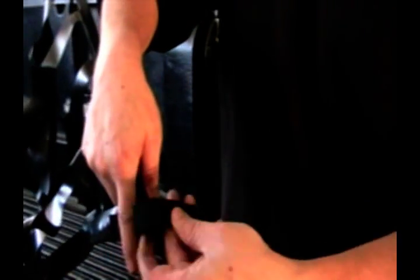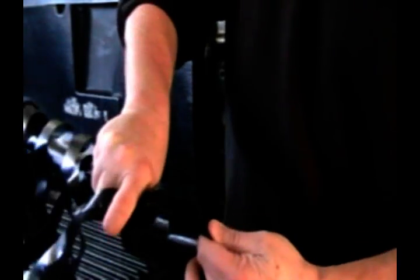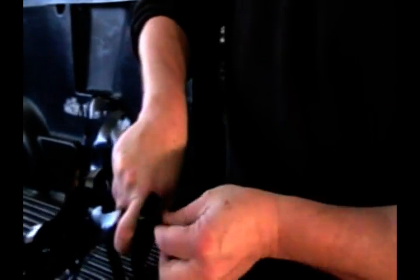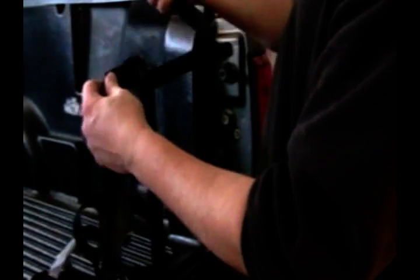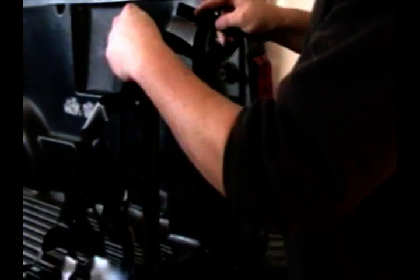What you do is come through the back side of the hole closest to the back of the buckle, then come back through the hole closest to the end of the buckle which has the little thumb catch on it, and pull it through like that. That way it tightens up on itself and the wind won't pull it loose. If it doesn't have a diagram, make sure you do it that way. Usually the buckles will be on the inside of the bed so they're not visible from the outside, keeping the straps hidden. You can either cut the straps off or tuck them depending on how your particular net is made.